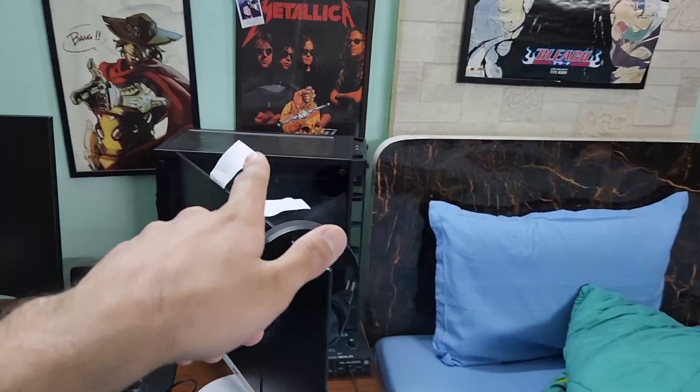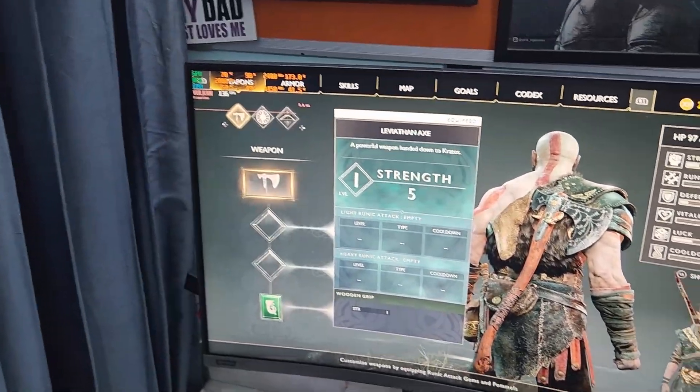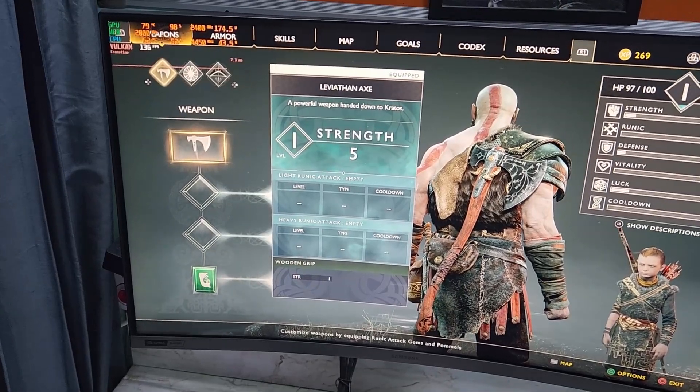My working theory is that Resizable BAR support on Ryzen 3000 is poorly implemented for some chips. There's literally no discussion online about it. Changing to this CPU boosted my performance in a DX11 game by 50-60%, which is amazing. I'm actually running it through DXVK, which translates the game into Vulkan — Intel has native support for Vulkan but not older APIs. I also tested the 5800X from another system and got similar results. I still need to optimize the GPU fan curve, but it's a very capable GPU once you give it a CPU with enough headroom.